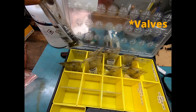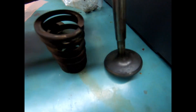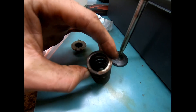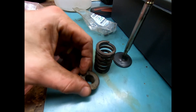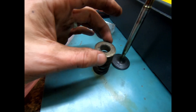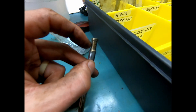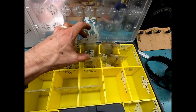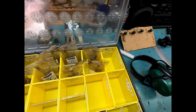All eight valves went through one pass in the ultrasonic cleaner individually, and they are significantly cleaner — not totally baked-shiny clean, but that's okay. I'm not worried about appearance on these; I just want to make sure they're all going to get a pretty thorough soaking of oil, especially under the collet, because there's really no oil that flows there — and that's kind of the issue for why they got baked on before.